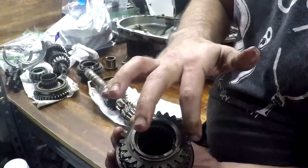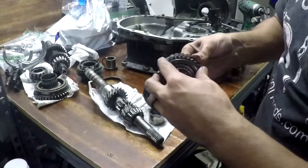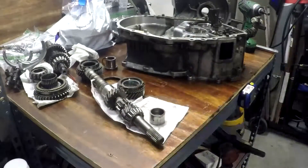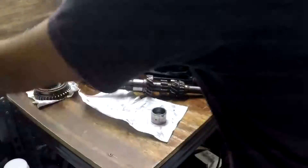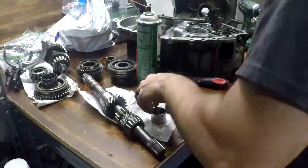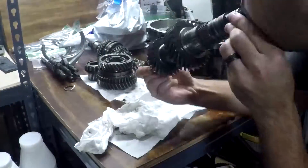Taking note of how some of these pieces are assembled — some interesting details like how the teeth are offset and there's one less tooth on one of those retainers. Checking some of our synchro wear here: this synchro is actually pretty good and could probably go another 20,000 miles, but underneath on the hub assembly we've got a lot more chunks of metal to pull out. We sprayed some brake cleaner in there and ended up spending a couple hours hosing everything down with WD-40, brake cleaner, and compressed air to try and get that metal out. It really just takes so much time to get it clean.